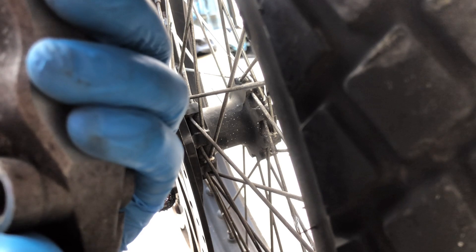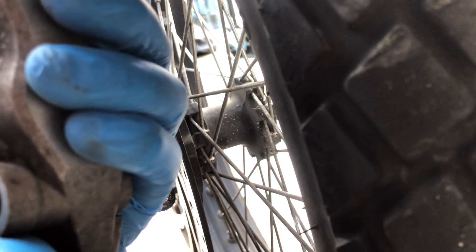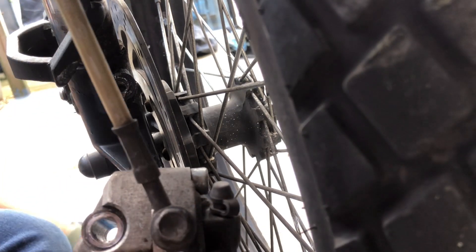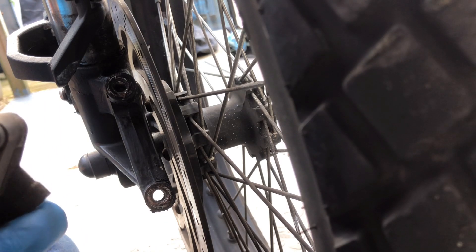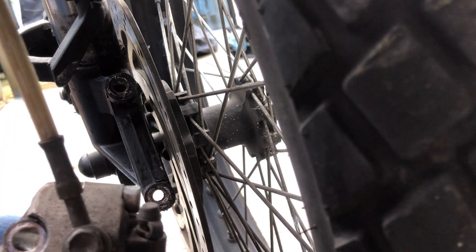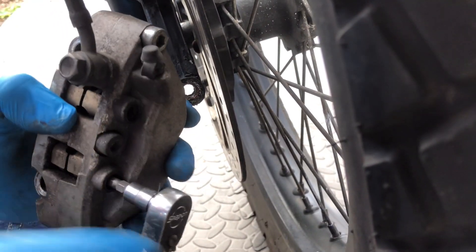Because of the central braking system, when you put your foot on the rear brake it applies to all, but I know for sure that pulling the front brake lever will apply a little bit of brake to the rear and obviously a normal brake to the front. So let's continue - we need another allen key which is down here, and it's a five millimeter allen key. So we've used an eight for the big bolts and a five for these pins.